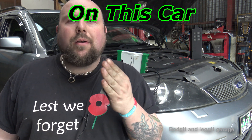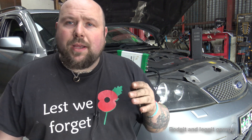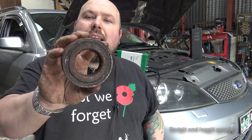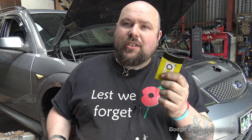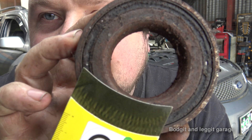If you've got a three-wire sensor you've got power, ground, and a separate signal wire, so you just need to know which one you've got. There are loads of ways they do it - magnet pickups, tone rings, and all sorts. With a tone ring you can physically see if there are any cracks or chunks taken out of it, but with a magnet-style sensor inside the actual wheel bearing you can't really see. You can get ones that look perfect and brand new but are actually broken. You can use a magnet trace card - put it up to the sensor and you can actually see the segments of the magnet inside.